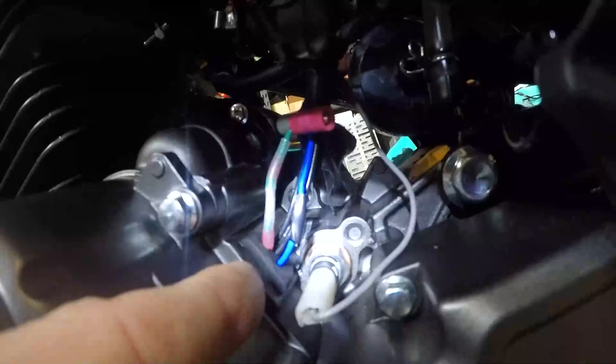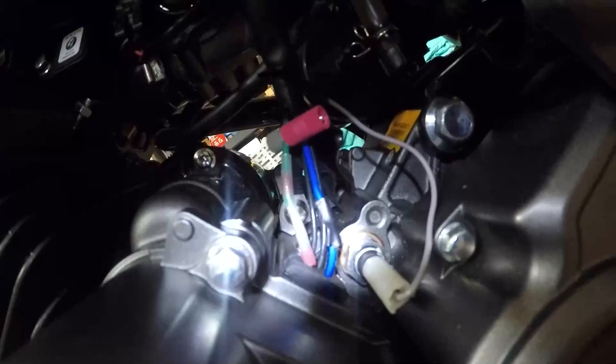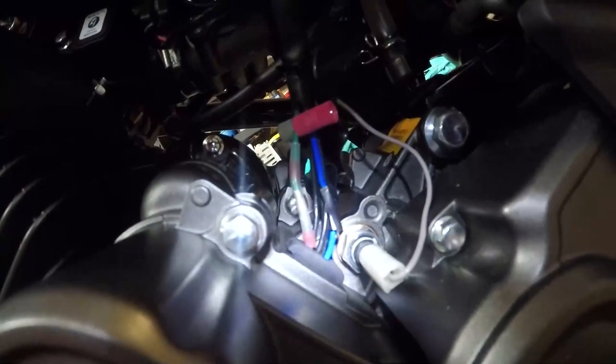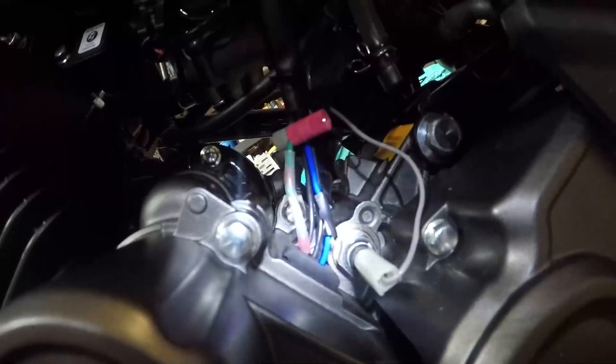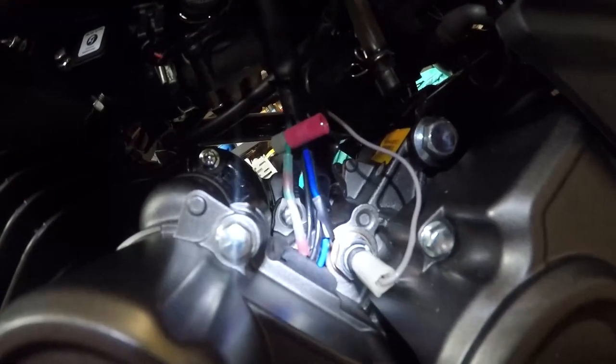And down the line, this is where the crankshaft sensor is. And I cut the sheathing away. On the wiring diagram, it says three white wires and a couple of different colors for the actual probe. I found three black, so I figure those were for the magneto, I think it is called. And so it was either a case of the blue or the green. I first tried blue being a dummy, thinking that was the one, and it wasn't. When I tapped into it, it exposed some of the sheathing, so I put electrical tape around it.